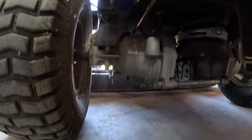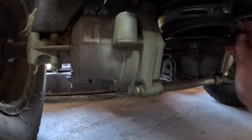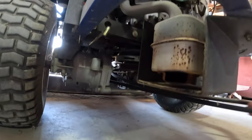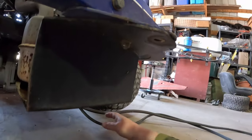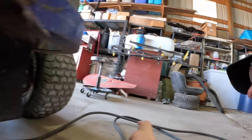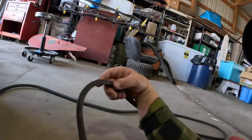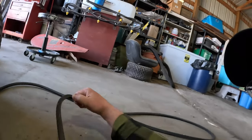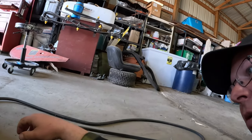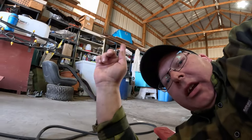And we'll see here. Right here is where it's sitting on the clutch pulley. Loosen that, or take it off rather, and then it should pull out. There we go. And notice, it does have some weird twists in here. That's what I think. Could be a broken cord. Something happened to it. Just won't stay on anymore. So now we'll get the new belt and we'll just do this in reverse.